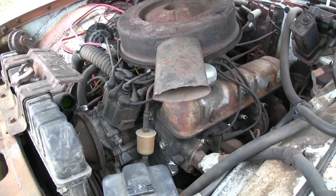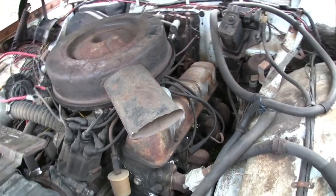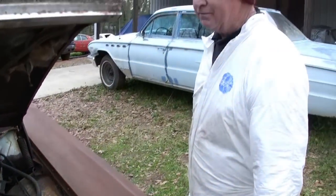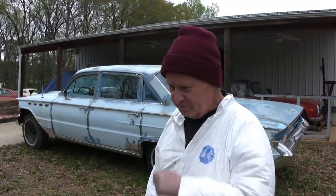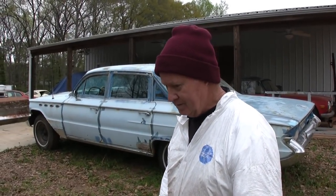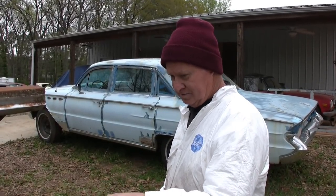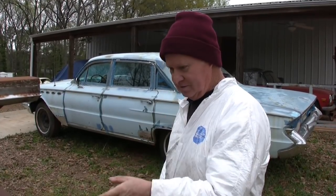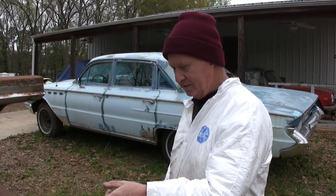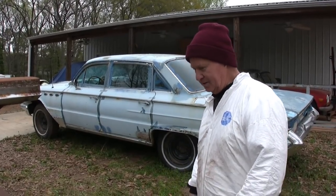That's called the small block of the United Kingdom. Buick sold it to Rover or somebody, and they're all over the United Kingdom. They're everywhere, even to this day. That's probably the most popular engine that they use, and there's plenty of parts available for it. I know when this car was new, the only problem I recall was that the copper-brass radiator wasn't really compatible with the aluminum engine and had cooling system problems. We'll try to put an aluminum radiator in there if we get this running with the 215 engine, and that'll take care of that problem. Anyway, it's got possibilities.